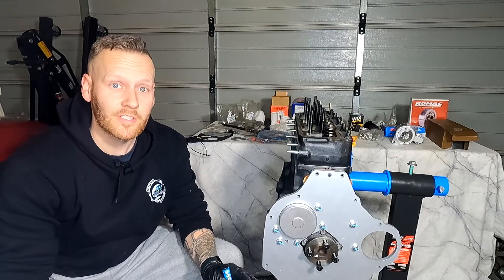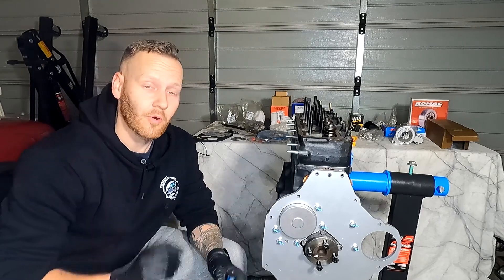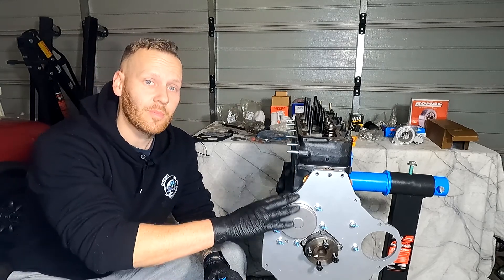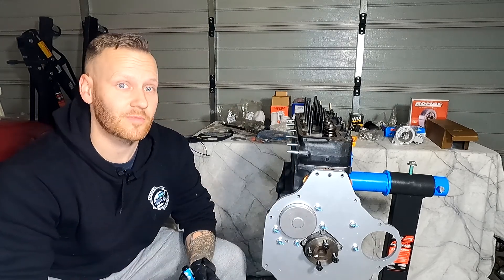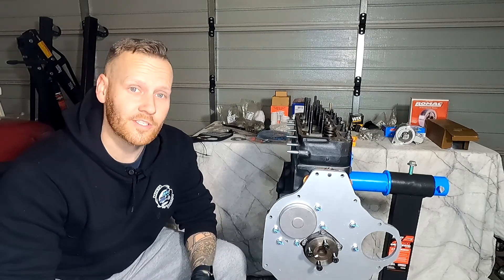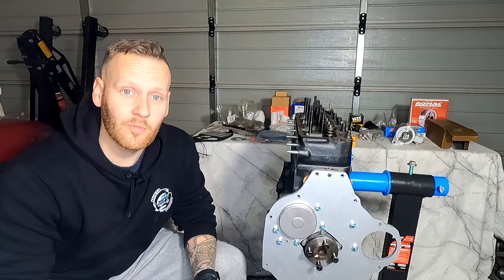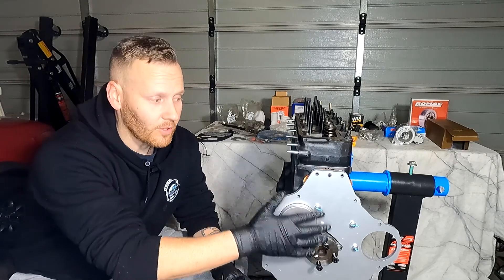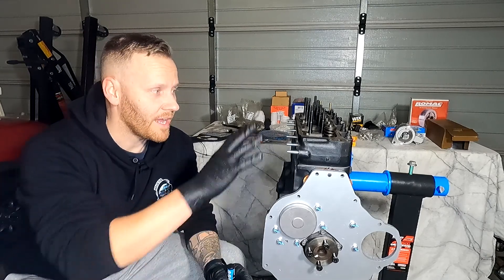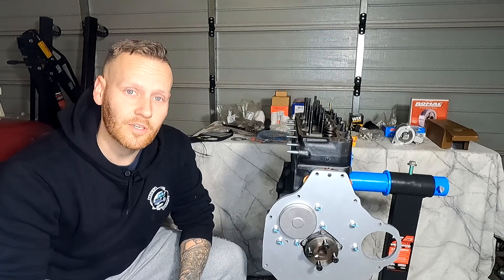That's it for this episode — hope you guys learned something on how to install the camshaft, oil pump, and rear timing case on a Morris Minor. When you go to install the oil pump, always pull it apart regardless of how new it is — whether it's been built straight from the factory or sitting in a box for 15 years — and always check the oil pump clearances as per the video on AC Dodd's channel. There's plenty more to come: next episode we're going to put the flywheel on, the clutch assembly, and probably even mount the gearbox before moving to the front side of the engine to do all the timing and the rocker gear at top. Stay safe and see you right here on another episode of Tomo's Tuneups.